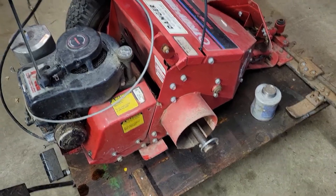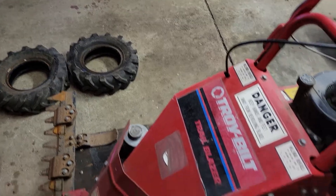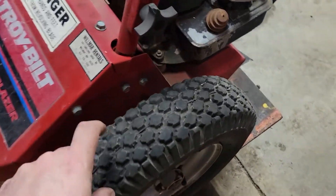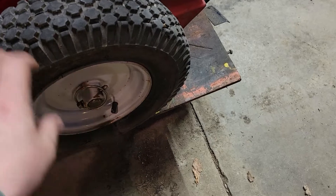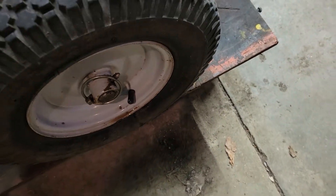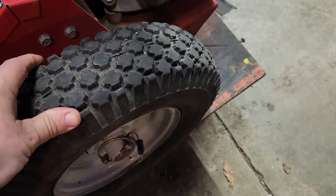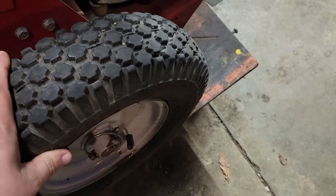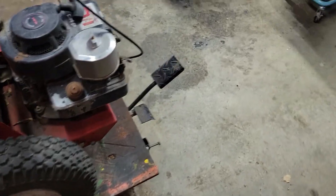As you can see, I got the wheels and tires off the rims and this side's already done. I wanted to get some ag tires like that, but I couldn't find any. These tires I already had on rims, so I had to take them off those rims because the shafts on this machine are gigantic. I had to use the original rim for this machine, so I had to take these tires off their original rims to put them on these rims.